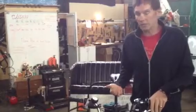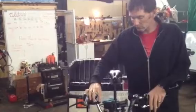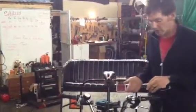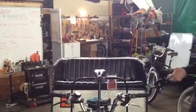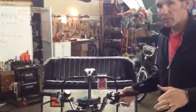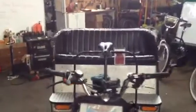Lastly, if you anticipate riding after dark, make sure that you have some form of working headlight. We have a number of different styles, but make sure you have one that works — you want to be seen out there. If you find that your lights are not working, the most common cause is things not being connected at the battery. Check your battery connections. Sometimes it can be right at the battery terminals, but more commonly it's at the charging plug that things have not been plugged back in.